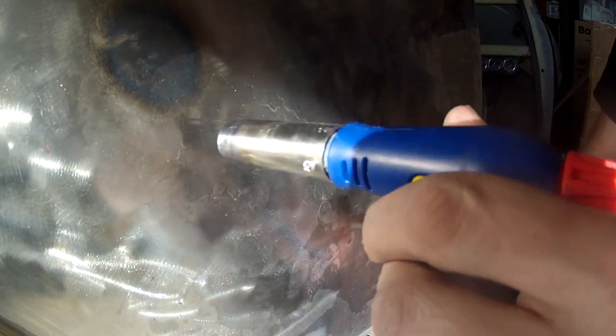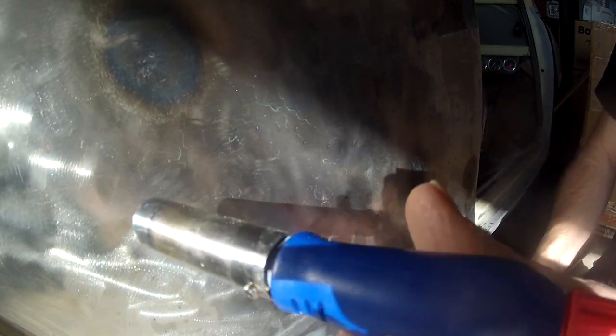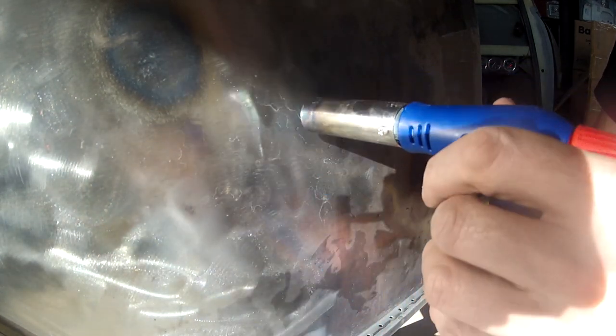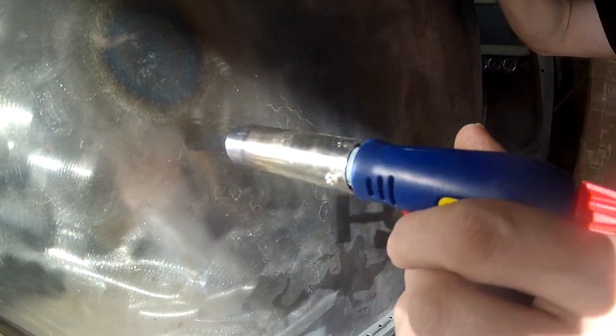And yeah, if you use the slider on the video and quickly skip through the section, fast forward and rewind, you'll see the metal bulging out as it gets heated and then contracting again when it's cooled. So it's very effective. Now that I watch this back, I realize I was using a bit too much heat, because it actually ended up pulling itself in too far in some spots where I had to use a bit more filler than I would normally like.